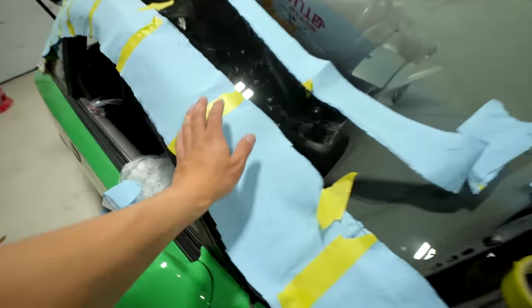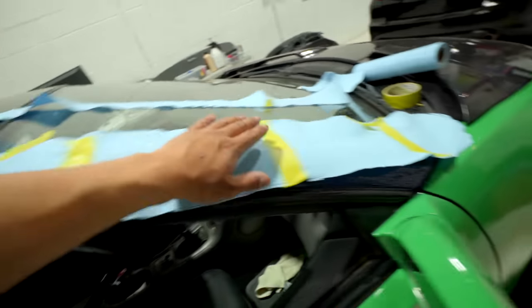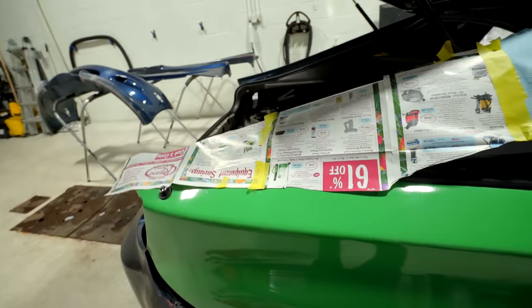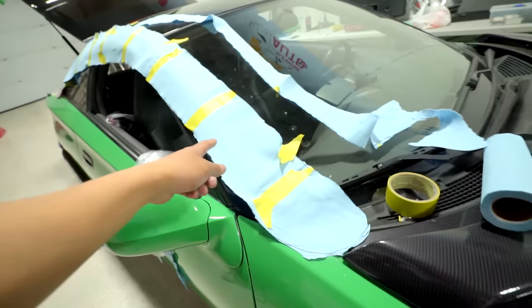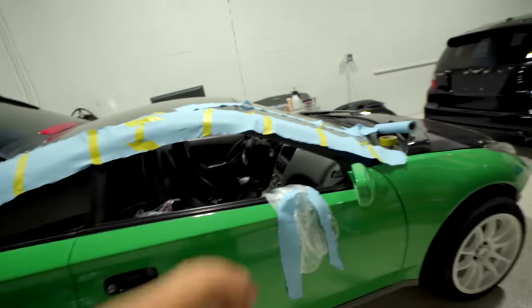I ended up using paper towels to make our pattern silhouette of the top, because once you take it off it's not a straight line — it curves down a little bit. This way we utilize as much of the wrap as we can without waste, and it makes it easier so you're not over-stretching areas. We can shape it up on our black matte wrap and it should make it easier to lay down instead of cutting a huge rectangular piece.